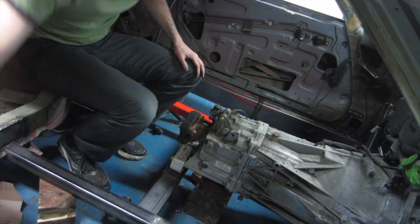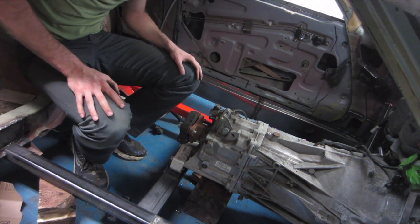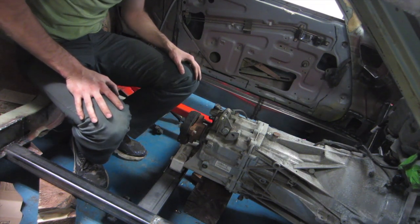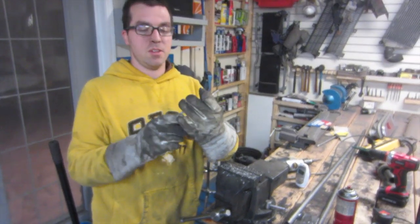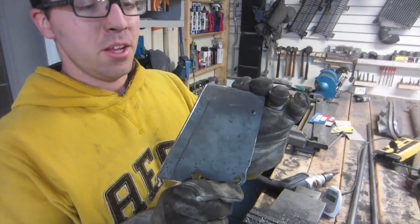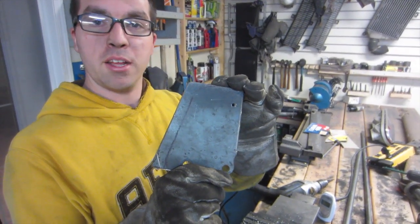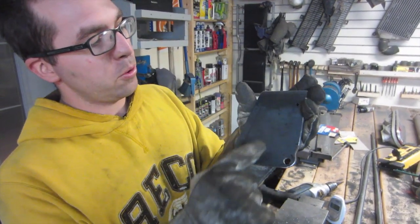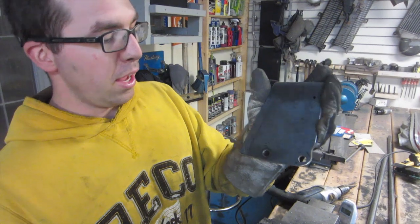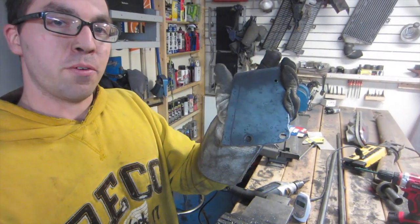Just the tops done. Do you want to try to weld the bottom or are we going to lift it up later? We could jack it if you want, but maybe get the sides for now. I did the top and the sides. So tell me what you're working on here — I've got these pieces Tony laid out the design for. I got this one and another one — this is the engine mount bracket. I drilled the bottom two holes out, I've got to drill the top hole, and that's where we'll be bolting this plate right onto the engine block. Then we're going to put a flange on both sides for a little bit of extra strength.